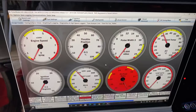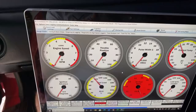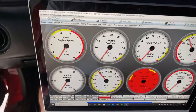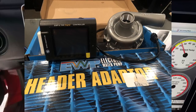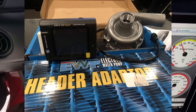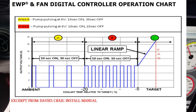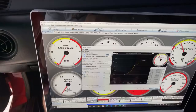This ECU does have launch control, but the better ones can control torque and manage it based on driveshaft speed to an individual axle against RPM. The better ones generally have better computing power and data acquisition frequency. They also have more inputs and outputs and the ability to drive digital and analog external devices. If you have an electric water pump — like I will in the Ultima — it usually runs without a thermostat, so you have to cycle it on and off during warm-up, with deadband and anticipatory ramping. Better ECUs can do that without a separate add-on controller.